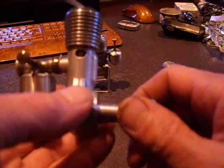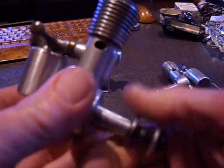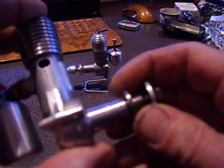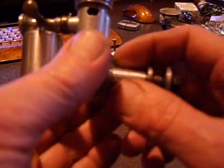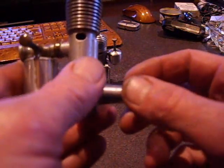Compression is around 60 to 70 percent — still enough for running nicely. Nice pop coming out, but it could use a new piston. Also a little bit of radial play in the crankshaft, but no problem. You can run it with the second or third flip, maybe even the first one. So let's go outside and check.